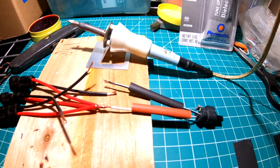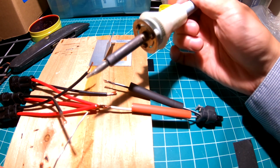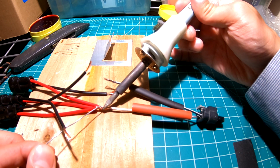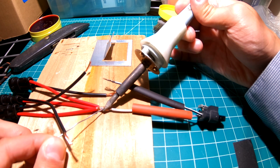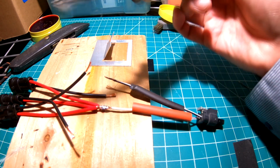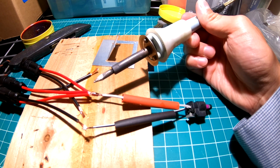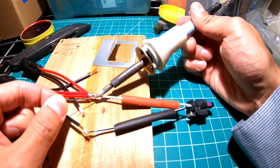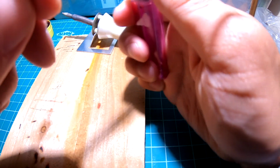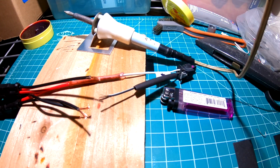Dropping some lines of solder. So the key is you place this on top. Oh yeah, sizzle, sizzle. Let it heat up and start feeding that beast. You'll get a nice flow in there. And we'll do the other side. And we'll shrink wrap, dielectric grease it, and we should be good. And there it is. Red side done. Move on to black.